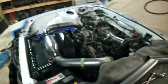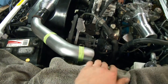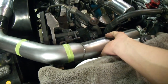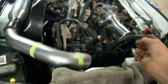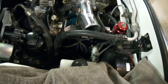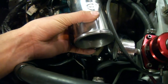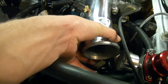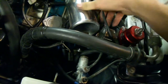Another day, more intercooler piping. I've made it this far - taped it together with a little pie cut piece to go down. I've got this piece which fits in here and points me straight back but I need to turn it back to the left a little bit. Here's the ultimate dilemma - I bought this fancy Rotary Works three-inch inlet, but it hits my oil filter, which sucks. So I have to shorten it because once I put a coupler on there it's definitely going to hit the oil cooler. So we're going to have to notch this back a little bit, which kind of sucks - I have to cover up the fancy Rotary Works logo, but that's okay.